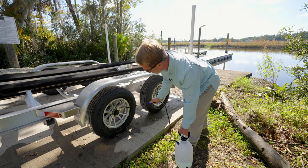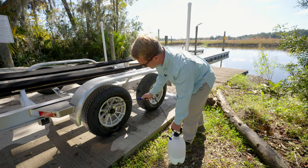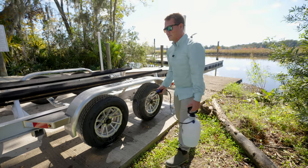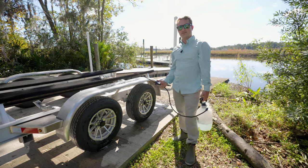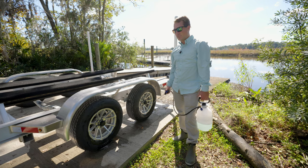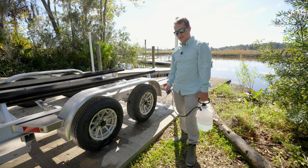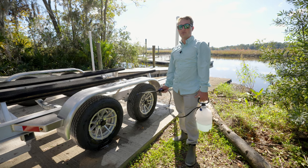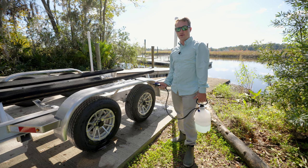This is just going to eat all the salt deposits off of the trailer, the rim, rotor, everything in there, protecting it from rust. Even just going in and out of the water one time, having that salt sit on there for an extended period of time, it will start to eat into these components. So just keeping it clean and salt-free is really a huge part of maintaining your trailer.